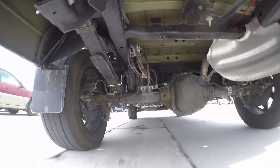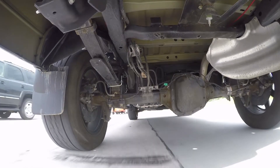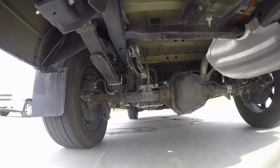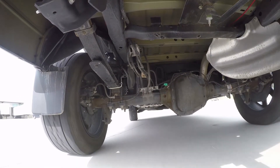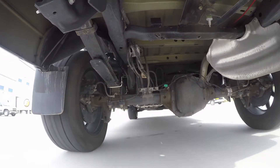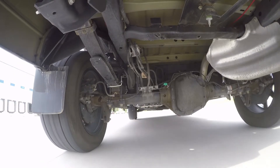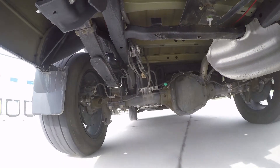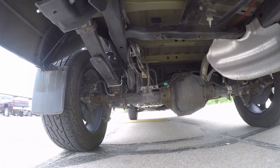You're still limited by the factory specifications for gross vehicle weight rating. If we're towing a trailer that has a very high tongue weight and is bringing down the back end of our truck, this will help raise it back up to a factory ride height. The reason we want our truck at factory ride height when we have a heavy load in the bed or are towing a heavy trailer is that it improves handling characteristics, increases steering and braking ability, and causes less tire wear.